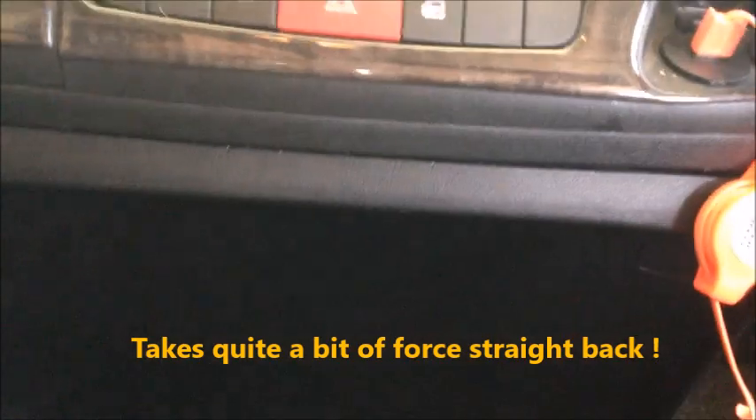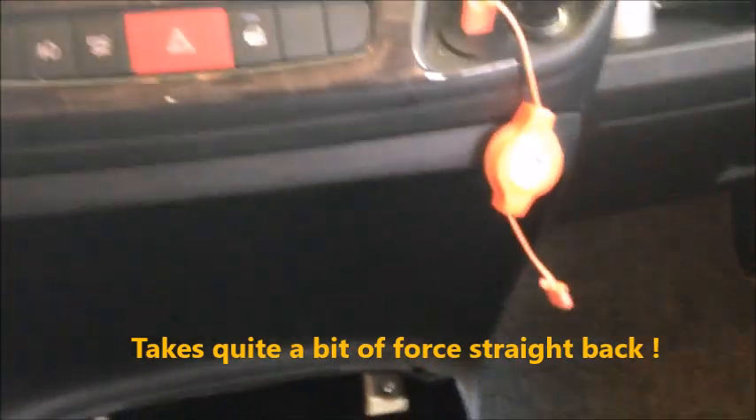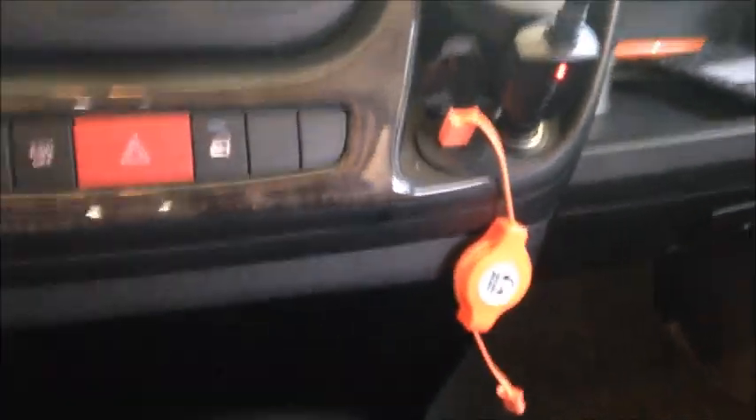It's very simple to do. Let me show you quickly — you can take this panel out. There are two screws right there, and a cover plate there. Pop that cover plate off, there are two more screws up here. Then you can grab this in the corner and pop it out — the whole thing comes off the front, and you can access that cigarette lighter fairly easily.